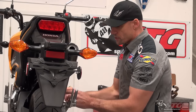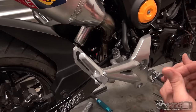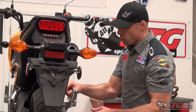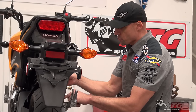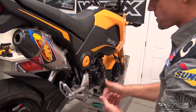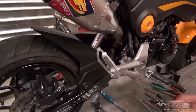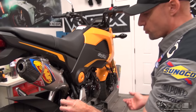The rear brake light switch is going to be another challenge. If retaining it means something to you, we'll need to put in a hydraulic actuated banjo bolt right back here and wire it into the brake light switch wires — very easy to do. We'll do a video on that for this bike down the road, but up front, know that you're going to lose the passenger pegs and the brake light switch.